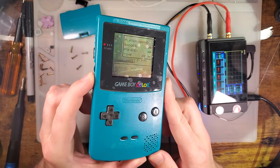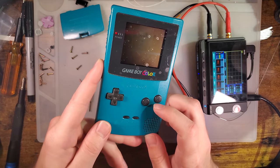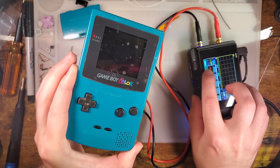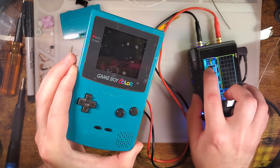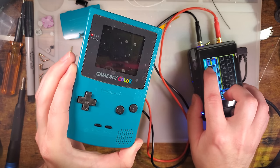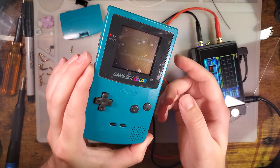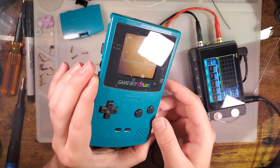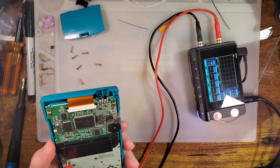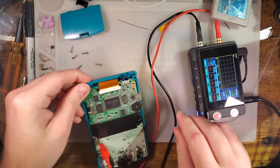I'm gonna go ahead and save. And in the overworld, at 2.4 volts, it is pulling 83 to 99 milliamps. 83 to 101, which is pretty much on par for what we did expect. But it's always good to have a baseline number. And then let's go ahead and try out the kit.